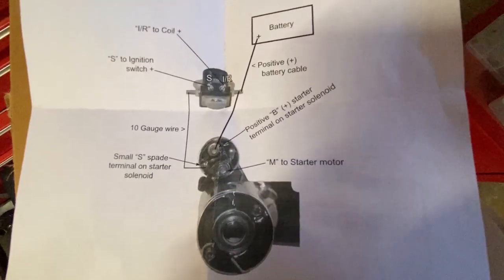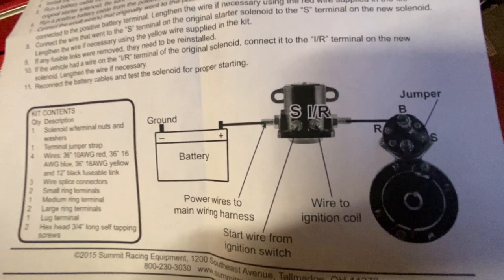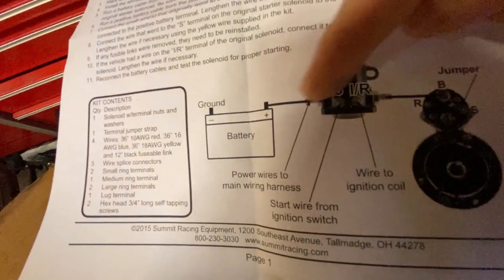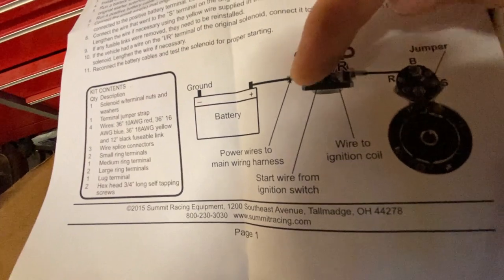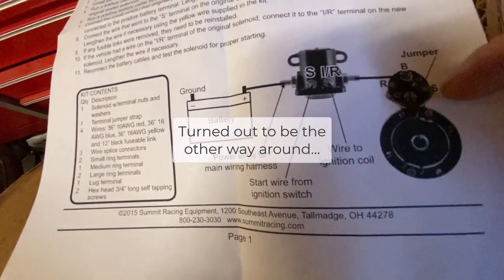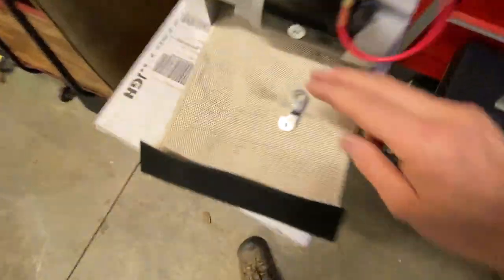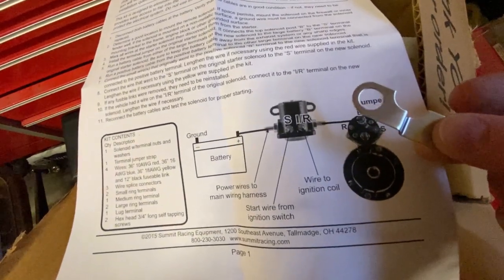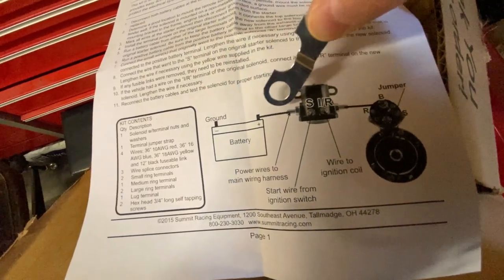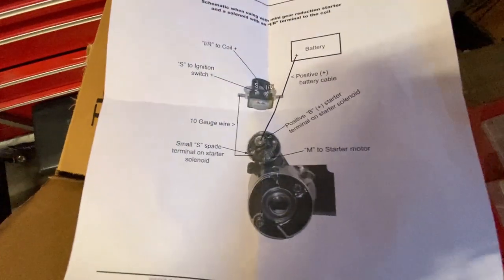The first thing I'm going to cover in this installation is the wiring. Instead of going straight to the starter, we're putting this solenoid in between. Our switch wire — the yellow one — goes to the solenoid instead of the starter, and the ignition wire — the purple — goes here as well. Then they have this little plate that makes the bridge. We've got power here, but we never have power down at the starter at all except for when we are actually starting.